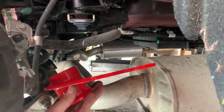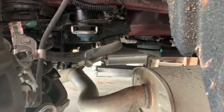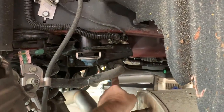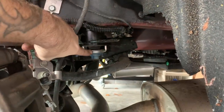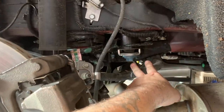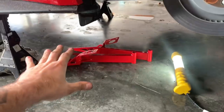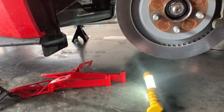Here's the back piece and how it's going to work. We're going to loosen up the back bolts holding the sway bar in place, and then this is going to mount underneath all of that — bolted there and back there onto the cradle. You're going to get zero movement from that bolt because it's going to be locked in 100%. Up front you've got three points of contact, and then in the back as well. I think this kit is going to be worth its weight in gold for barely any money at all.